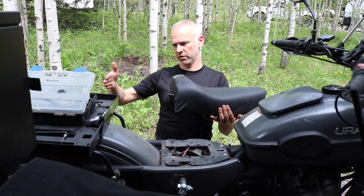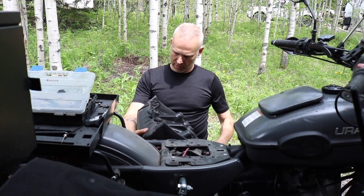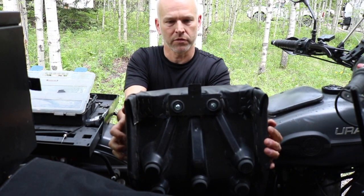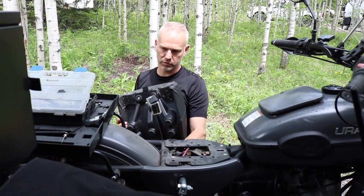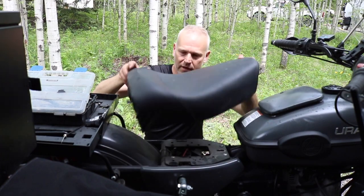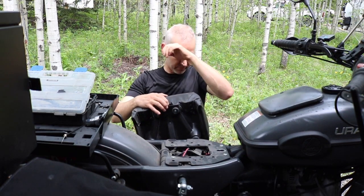The seat had another piece on the back that came out to about here, and that's the part that bolted under the fender that was such a pain. What I ended up doing is I cut the seat off myself — just used a hacksaw — retained all the foam in here, re-glued it, re-stapled it all underneath, and put it all back together. This little plate here with the tab on the end of it fits perfectly up into this little hole right here, which is specially made just for that. These two little pads came off the back side of the seat — I basically just screwed them through with some washers and that's been holding really well.